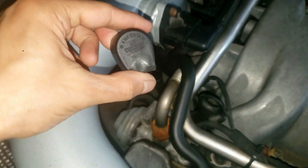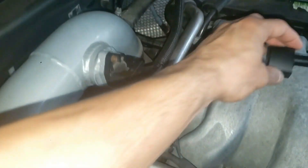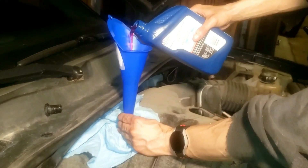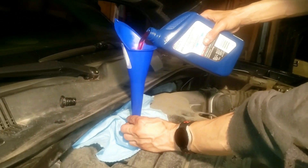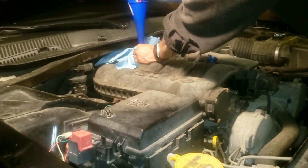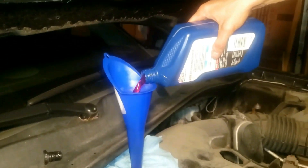If you have a Mercedes or Crossfire car, then instead of a twist cap you'll see a red tab here. This car has a piece of tape covering it temporarily, but just use a flat tip to pry it upward and pop it out. If you just drained your transmission oil and reinstalled the drain plug, you'll want to add the same amount back in with the new approved transmission oil type, or put in the exact amount as indicated in the owner's manual. I suggest starting with less initially.